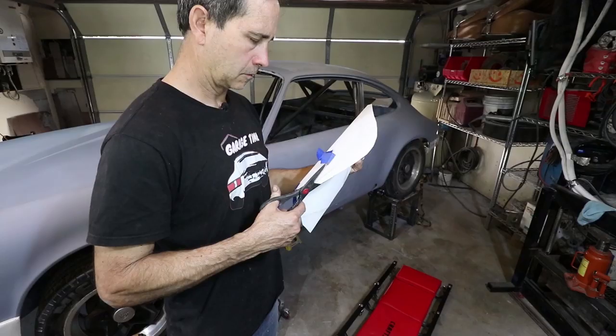More TIG welding to do on this thin panel. Along here and on the back this is really difficult — this metal is really thin because it's stretched when they form this piece. You can see some areas that have blown through with the MIG welder. I'm going to have to go back over this with the TIG welder and go real slow to try to fix that up. This is now 100% welded in. This was a lot of work and very time consuming, but I'm happy with the way it came out — this is very solid. Right here is the area I went over with the TIG welder, kind of filling up some of those burn-throughs.